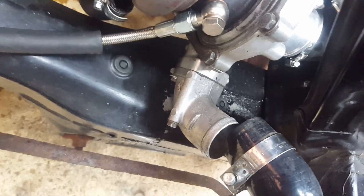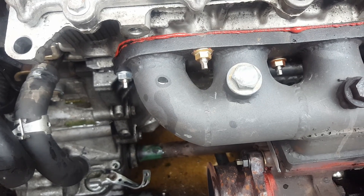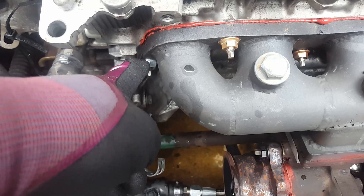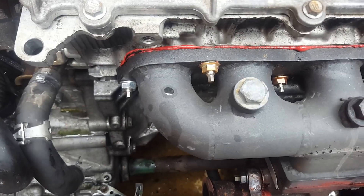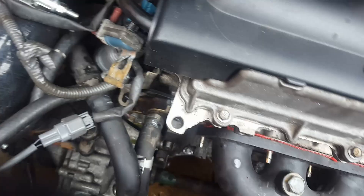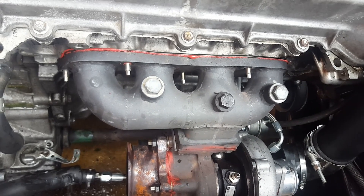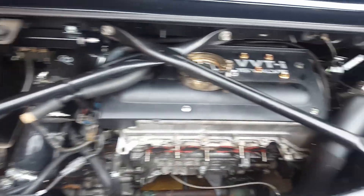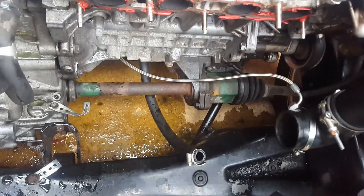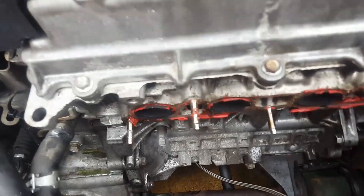Almost forgot about that little bugger there - I've just undone that, so now manifold bolts. These two nuts that went missing - that one and that one - I replaced them with two copper coated steel bolts again, and that one actually made a run for it again, so this time I've put a mild steel nut on there and tightened the absolute crap out of it. All the nuts are off now - look at this, still solid on there! So that red sealant is a beast, I'm gonna have to try and pry it off with a screwdriver.